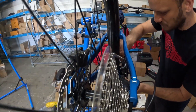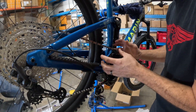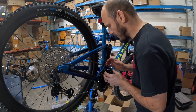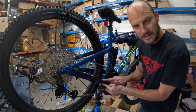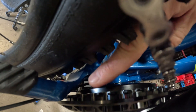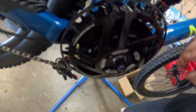You've got all this componentry that's made to swivel your swing arm, so you've got to bump out the chain. What we were having here was just a nightmare — we had to play Goldilocks with like eight different chain rings. Either the motor was too far in and no chain line would clear right at the chainstay. Your teeth are hitting this chain stay; it's a really aggressive chain stay — it comes out from the bottom bracket and then takes a hard left turn, and the teeth were just hitting it.